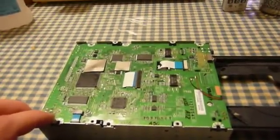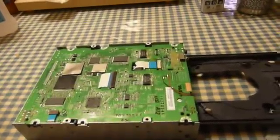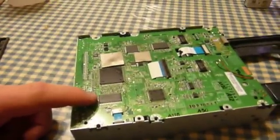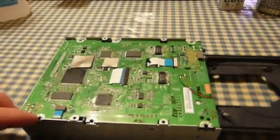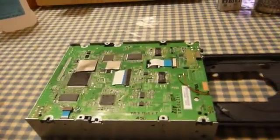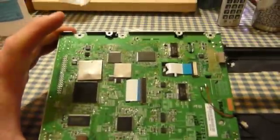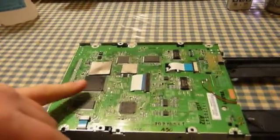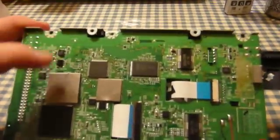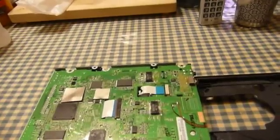If you look at a newer drive, you're not going to find all these components on the board because practically all newer drives are made by LiteOn these days, and they've benefited from a great deal of increased integration. Most any drive made anymore simply has the buffer memory chip, possibly a firmware ROM, the servo drivers, and usually a MediaTek chip that gives the drive its personality and makes it able to burn and read disks — all in one bundled part. But this is an older drive, so it has some discrete chips. I believe this NEC chip is the connection to the parallel ATA bus, and this up here is a Hitachi H8-SX-1650 microcontroller, which is H8-300 compatible.